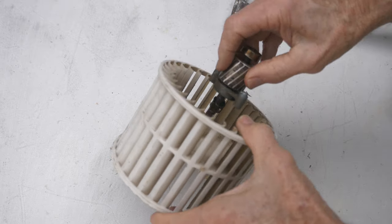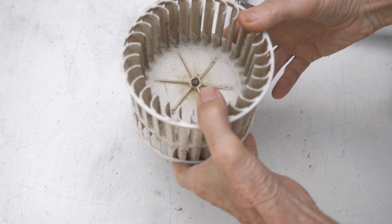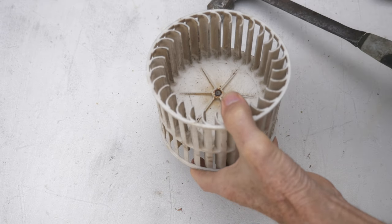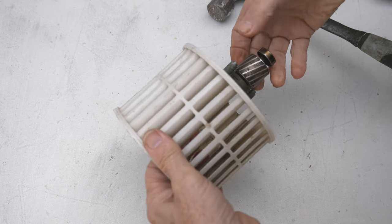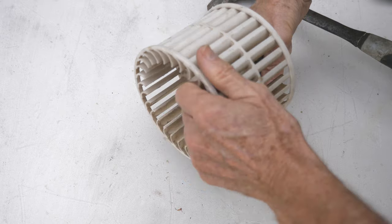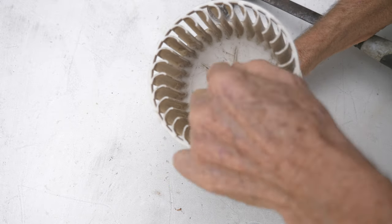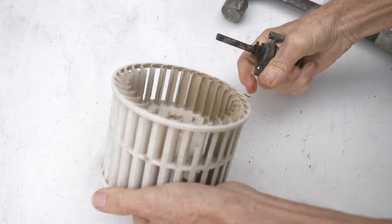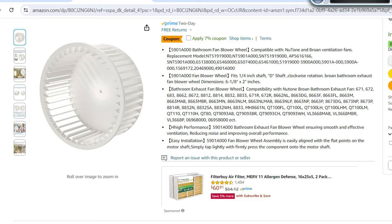The rotor is the part that moves — when this moves, the fan goes around. I'll put my pliers right in here to get that clip loose. I'm going to see if I can start it moving — yeah, it went down just a smidgen. I'm going to grab the rotor and turn the fan to work the shaft out, going back and forth. There we go — the shaft is out of the fan. By the way, you may be able to buy a new blower fan for your model for perhaps $10 to $20 online.